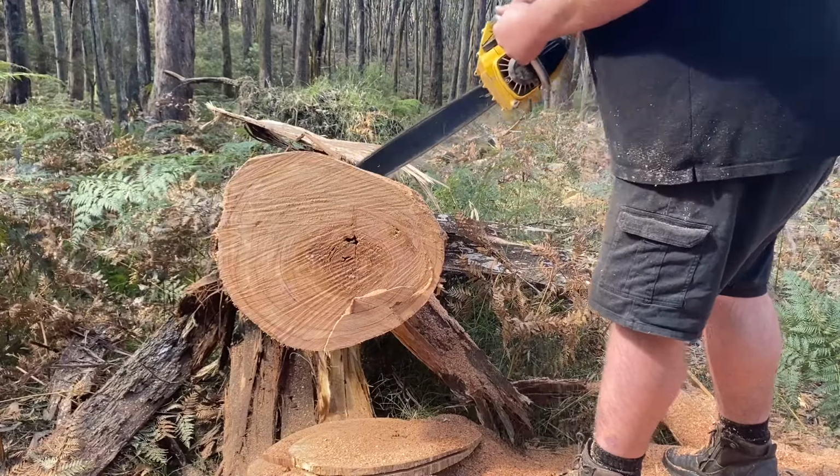I've got an Iron Horse style pipe at home that Darcy made for a CS5000 Echo. It's about that long. I could probably stick my thumb in there. It probably needs a little bit bigger pipe, probably 22 mil, which is the next size up from 3/4, 11/16 I think it is, or 7/8 pipe. I reckon I'd make an Iron Horse style pipe for it, or maybe a header pipe. Make it come out, curl back, and then put a stinger on it. I reckon it needs a pipe.